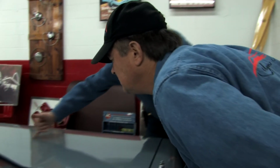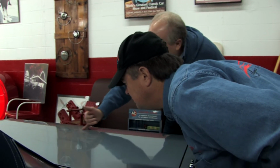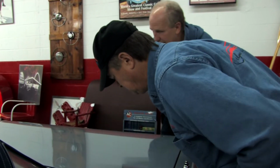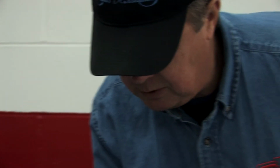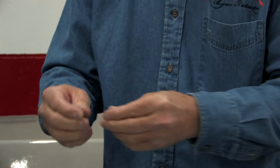And it's been blended. You can see the dryness. It's got a big blend mark coming through. And if you look real close, it looks like a leather texture. That's all those little islands of paint with a crack going around it. They finally will pop open, and it gets flaky and comes off. So usually this was probably air dry primer, air dry lacquer, and they just degrade with time. And anything you put on top of it usually speeds up the cracking.